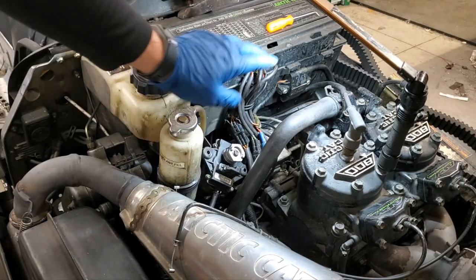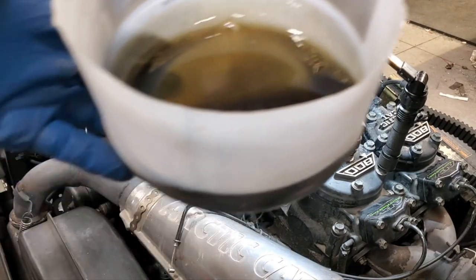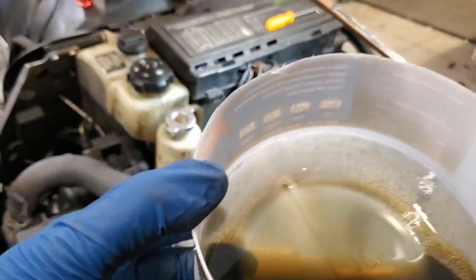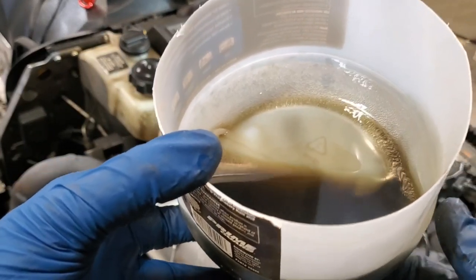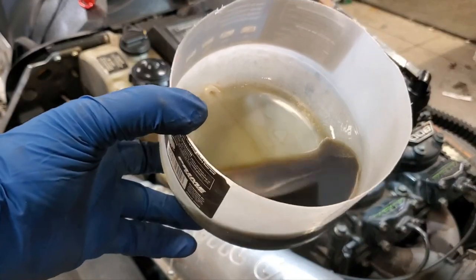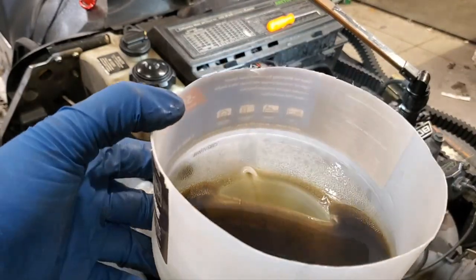So I obviously can't reassemble things until I get this sorted out here, but I've already contacted the guy, so we'll see if we can get the part in. But next, we can refill our chain case. But first off, what I like to do is I dump it in a clear container, and I try to look around in there and look for particulate. And then I take a strong magnet, and I put it on the bottom. It's going to be hard to show you here, but to see if any of that particulate actually attracts to the magnet, and nothing seems to be doing that, so our chain case is probably still in good shape. I did have the chain case opened up last winter too, just to take a look in there, and everything looked good there, but this is just more proof that everything's still running good there.